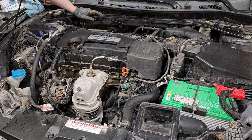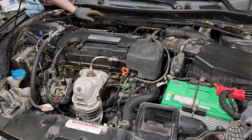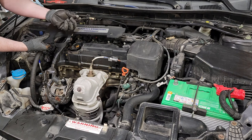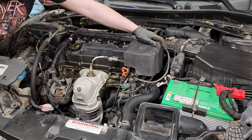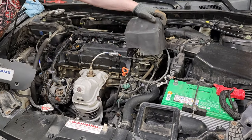I started it last night, and you can take this valve cover off in about five minutes if you fly through it, but I realized I should at least explain what I was doing. Step one, you're going to take this little cover off. You've got five little bolts — they've got a cool little shoulder on them and they're just 10 millimeter. Put that off to the side, pop this off. This is just kind of held in place with a couple little rubber gaskets — lifts right up.